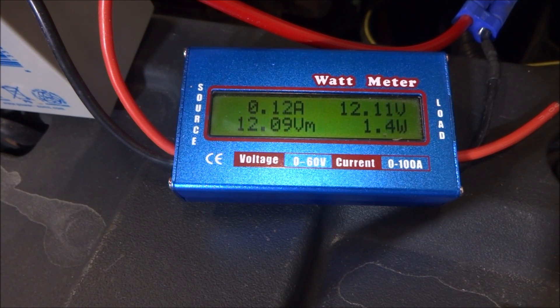Now, this is a 2014 Nissan LEAF — I'm told it will recharge the battery using the DC to DC converter every 24 hours if the car is left unused. So you will see a flashing light on the dashboard; the rightmost flashing light will flash. I've seen it on occasion. I'm not exactly sure if it is supposed to be exactly over 24 hours, but let's assume so. So if the car recharges the 12 volt battery every 24 hours, we can assume that all we need in theory is a 4 amp hour battery.